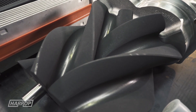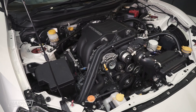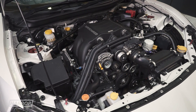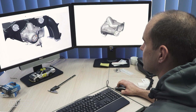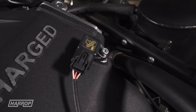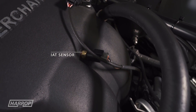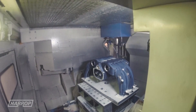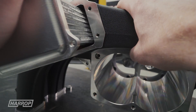All factory accessories like aircon are retained, with no cutting or fabricating required for the install. We supply one extension loom that covers throttle, MAF, and IATs, which is removed from the MAF card and measured from a new sensor post-intercooler to measure the actual IATs. One of the fundamental design criteria is to achieve OEM level of finish and ease of installation for our customers with the best vehicle integration.